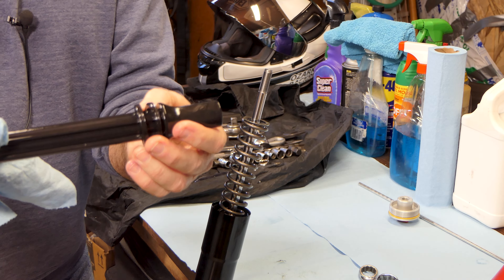In the end of this cartridge, if I lift the rod and push it down, you'll see a little pink aluminum valve with an O-ring on it sitting in the end of the tube. I'm going to take that out so I don't lose it, and then go ahead and dump the oil. That fluid actually looks pretty good — I'm impressed. I figured it'd be pretty nasty. The bushings will turn the oil black. There's also a spacer that came out that the spring was sitting on, on top of the cartridge. I'm going to set this upside down, prop it up, and just let it sit for about an hour.